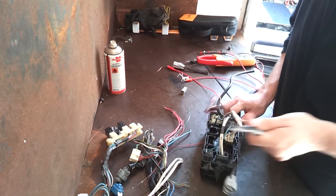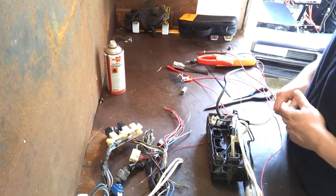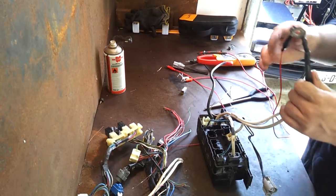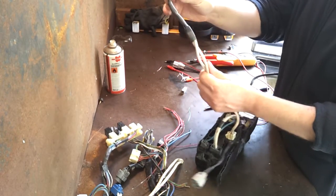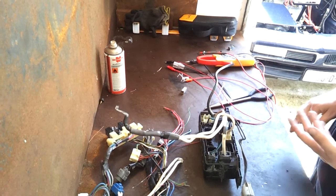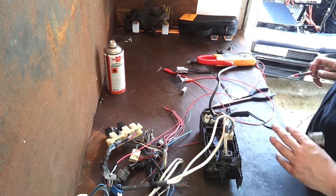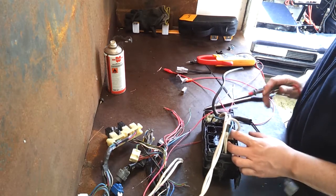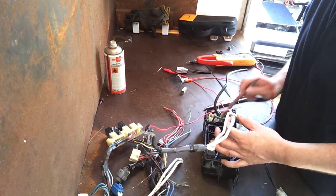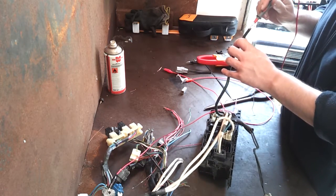Having a look at this block, the first thing I did was take off the bottom cover and cut out all the loom tape to get down to the high-current wiring. I've got two white wires here — this is the battery positive, which would have gone to the battery positive terminal in the original car. Using a clamp meter, the power comes in on these two white leads, goes through a 100-amp fuse first, then into a bus bar. This connection here would have been the alternator B-plus.